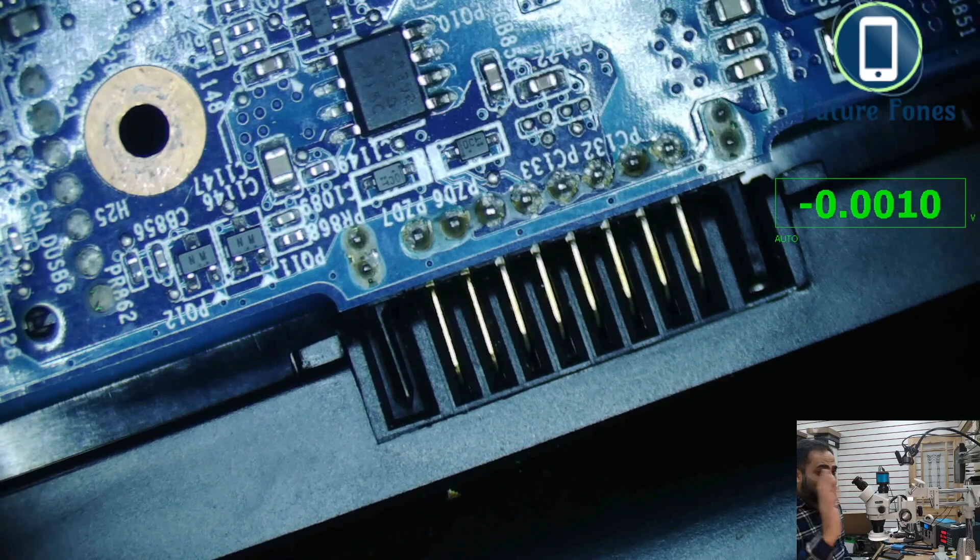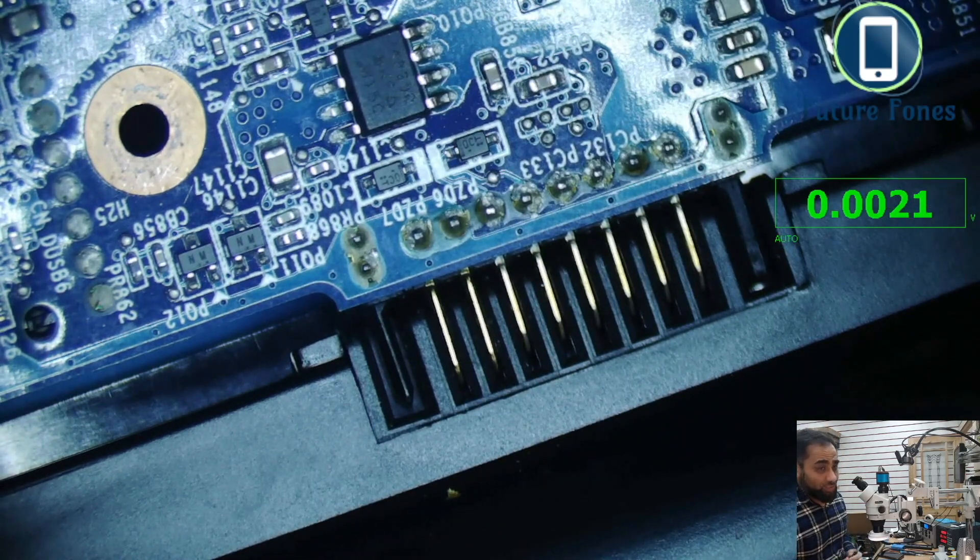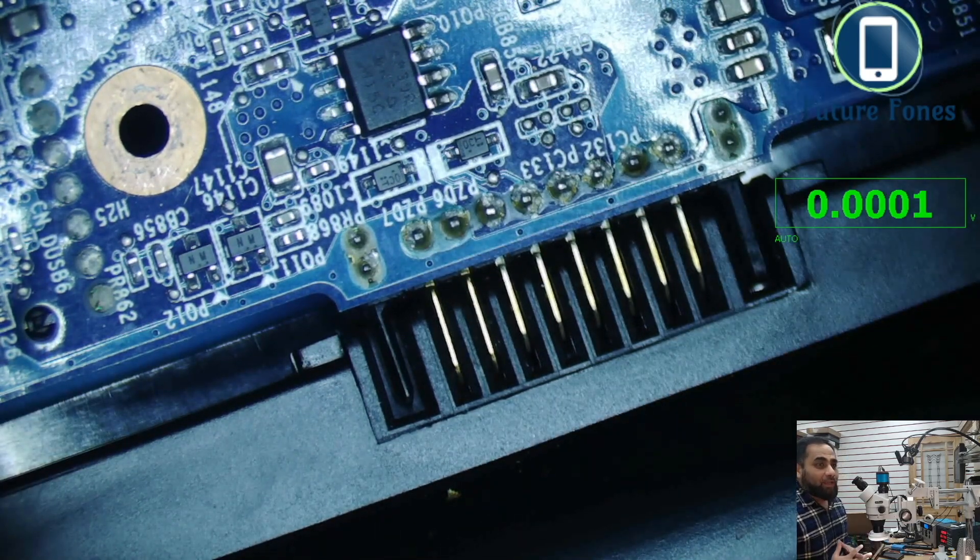When I say 'IC,' I mean the IC inside the battery pack itself. The SuperIO and the battery IC communicate together and provide information such as available voltage and estimated time to full charge. This was a small video explaining how the battery behaves when plugged into a laptop and how you can diagnose whether your battery is genuinely not working.